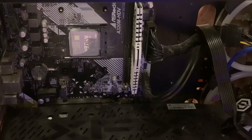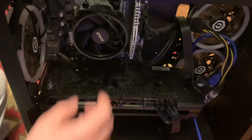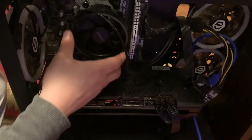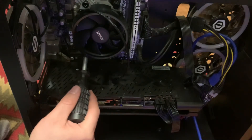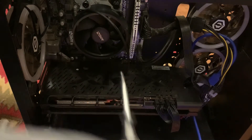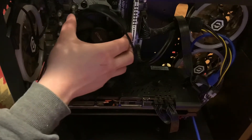Sometimes you might need somebody's help to hold the back plate while you screw this in. After you get this screwed in, you want to go one screw at a time - don't screw them in tight each one, just do it until it grabs that back plate. Do one, two, three, and four, since there are four screws total. Don't strip the bolts out; it doesn't have to be crazy tight as long as they don't move. Be really careful since this is attached to your motherboard - I've never cracked a motherboard before but you can find some scary videos of people doing that.